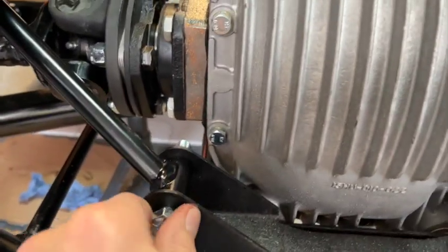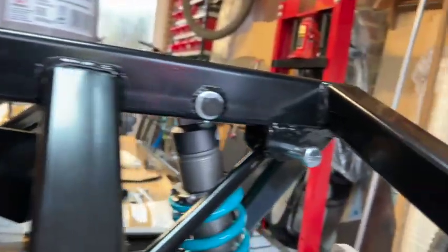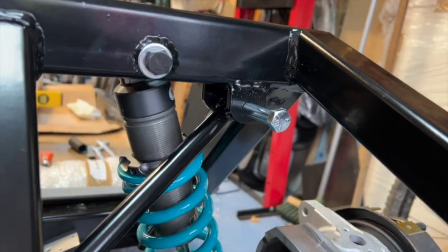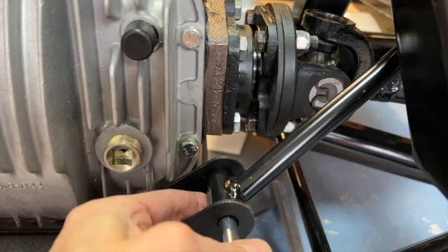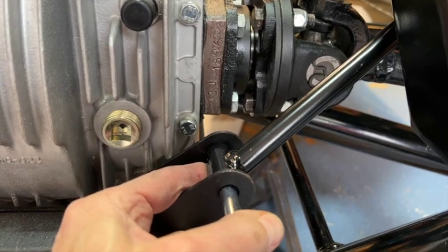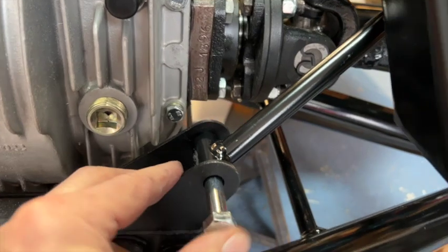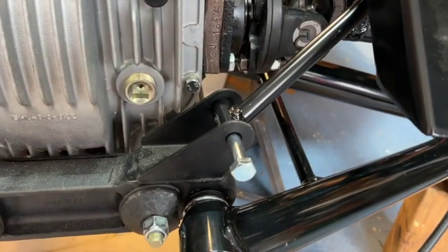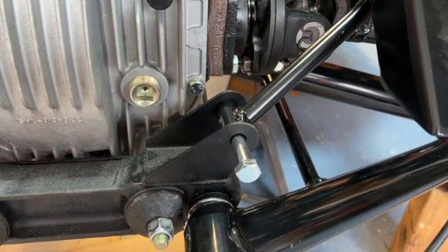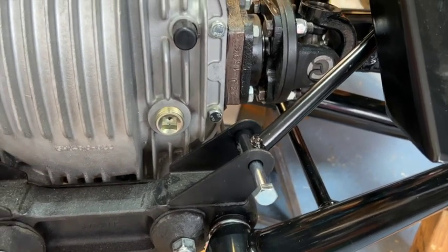This one is absolutely fine straight through. This one looks to be all right straight through. I can get this top one through, and this one I'm just going to give it a little gentle persuasion. It might not need much, but otherwise I'll just run a drill through just to take off a couple of mil of the hole on the other side, and then simply do some copper grease and nuts and washers, and you're all done.